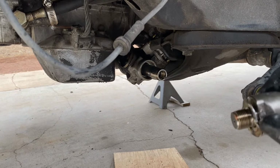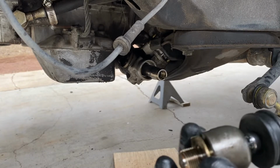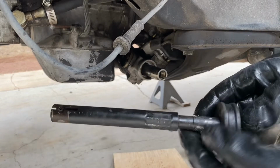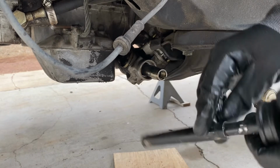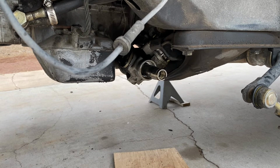And you can see right here an up close shot of the securing ring. You probably don't want to reuse this if you're going to be swapping these out and replacing it. It looks like online they're included with the purchase of an inner tie rod, but you can see with the E30 tie rod that there is a female portion right here where the outer tie rod threads into it. On the E36 and E46 models, there's actually just the male part with the threads. Now you could cut that female part off and you'll have threads there.